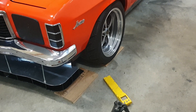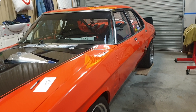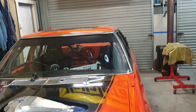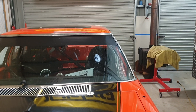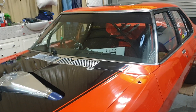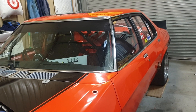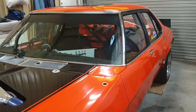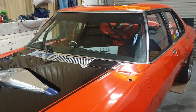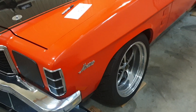Good day folks, we're going to weigh the beast — find out how heavy it is. I haven't done it in a little while. I've done a lot of changes: I've moved the turbo from rear mount into cabin mount, added an intercooler, done some weight reduction, pulled the window wipers and motor off, pulled the window winders for the doors, stripped all that out, pulled the dash and the heater assembly out of the car — there's a bit of weight in that too, with the core and all that sort of jazz.